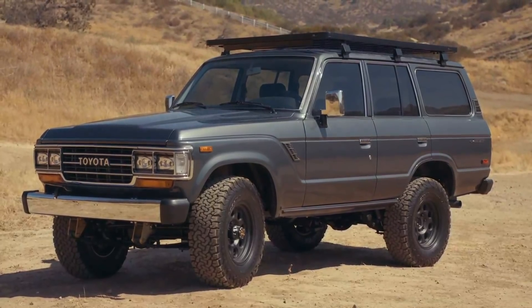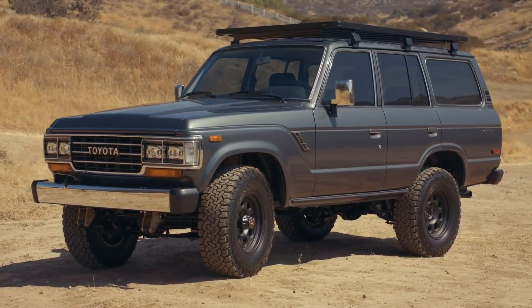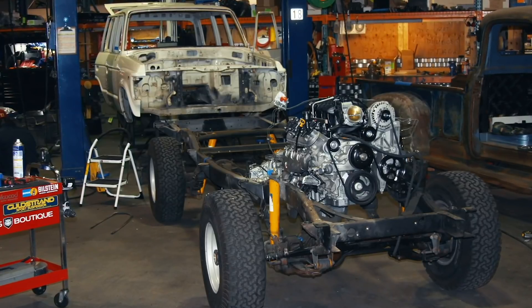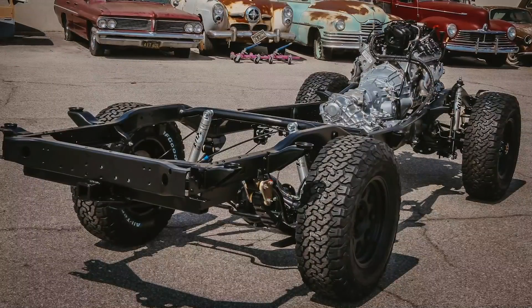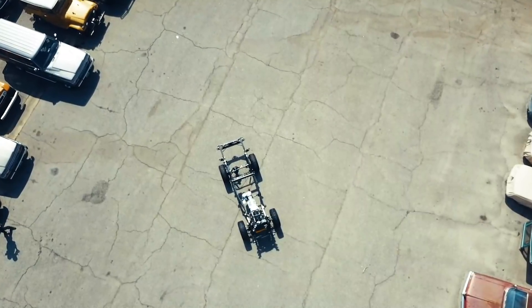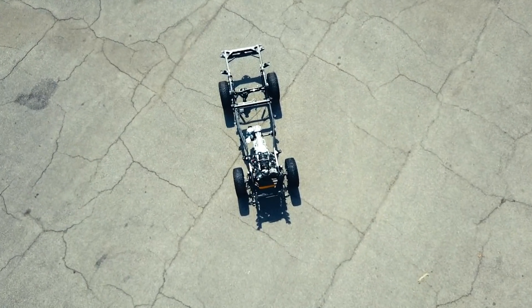This truck is what we call a stage three restored truck, meaning it went down to pretty much absolutely nothing — the bare ladder frame — and then up again. The frame is powder coated mil spec one, and perhaps more importantly, underneath the pretty black finish is an epoxy-based powder coat primer originally intended for underwater pipelines, so super durable. Pretty much every nut and bolt on the truck has been turned and addressed. It was literally a body shell and a frame rail and raw axle housings.